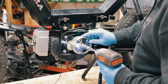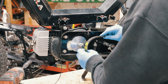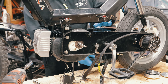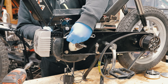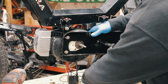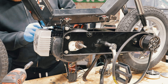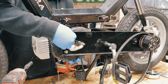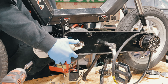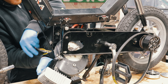First thing I'll do is pull the variator. You can drop the carburetor rail at the bottom like that. Now I need to take out the engine bolts — I don't want to lose these, I'm going to put them back together. You kind of have to tilt the engine a little to get it out. Pull the rest of the motor bolts and get these wires out.